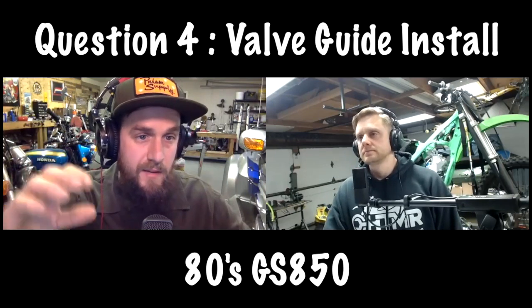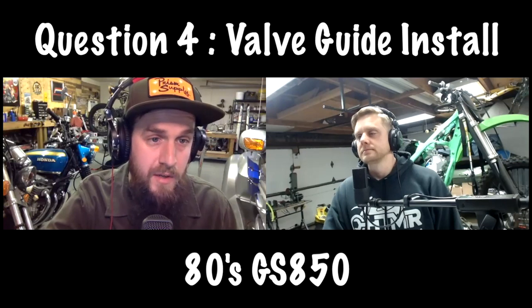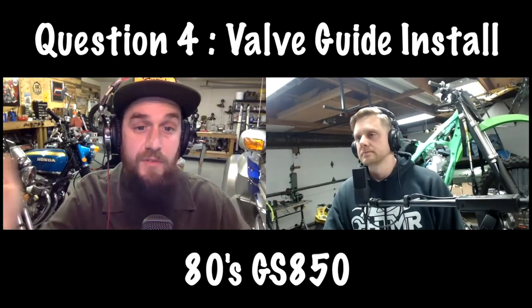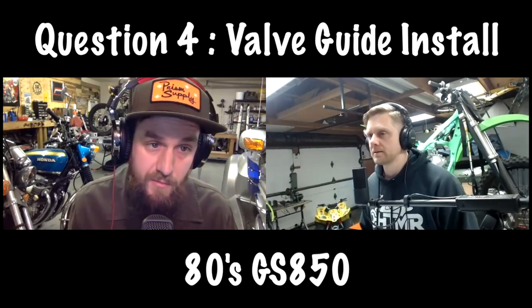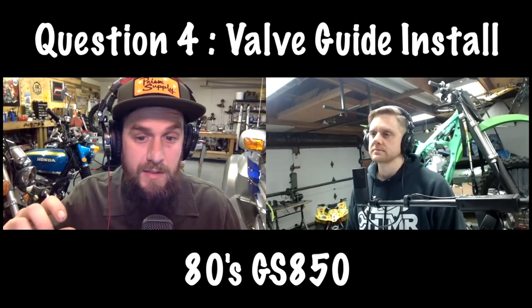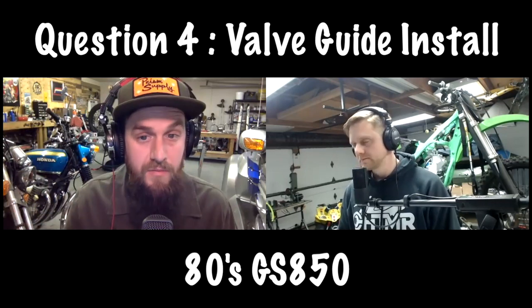The seat needs to be cut this much or this much, and that's what a head shop will do. A machine shop, but you can look and see if you're even in the parameters. You may be on some of them. You may be off on some of them, whether it's not even on the valve seat, or it's too high, too low, all that stuff. But you can do that yourself for sure.